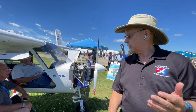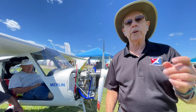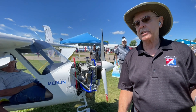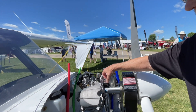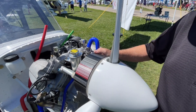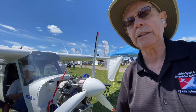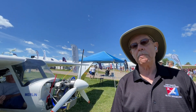I hadn't heard of molded hoses before, but Chip has found them and is making good use of them. Notice the red and green colors — that's because there are two fuel pumps on this aircraft, just for redundancy. These engines are made in volumes of 10,000 a month, so aviation use is a modest portion. Chip has done a lot of customization — for example, this oil element up here is an extra piece they've built for it. There are various other added components: the belt drive is another element he adds, and down here you can see the radiator, which is another custom item. This is an engine not originally made for aviation, but the lightness and twin-cylinder four-stroke operation is what a lot of people are looking for.